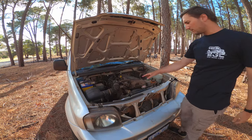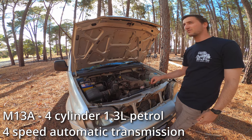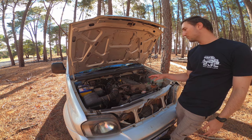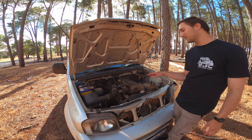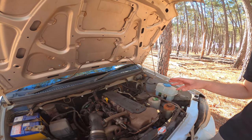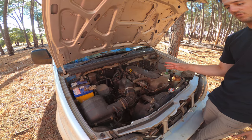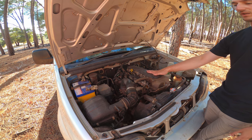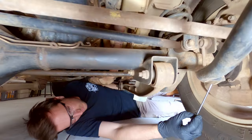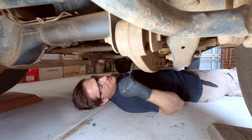Let's check out the power plant. This one's got the four-cylinder 1.3-litre petrol engine — the M13A — which was common in Jimnys from about 2000 to 2018, coupled to a four-speed auto transmission. Apparently it's done 47,000 k's, but based on the wear and tear, they're probably some of the hardest 47,000 k's I've ever seen. The auto trans fluid was a little low when we first got it, so we topped that up, and the coolant was a little low as well — we'll monitor those. We'll also replace the air filter when we do the major service. Service history shows it got a service about two months after purchase in 2008 — that's all we have, so we're definitely going to give it a good birthday.